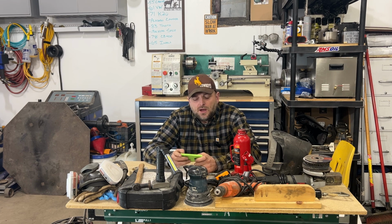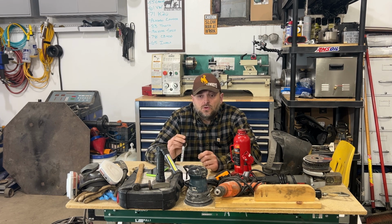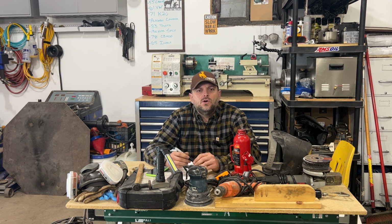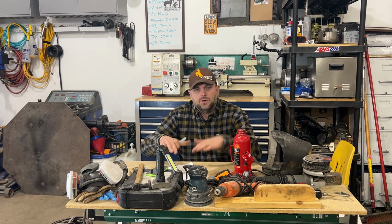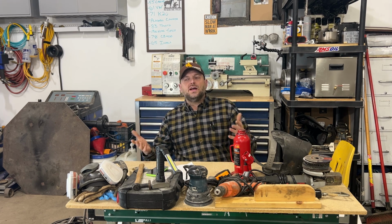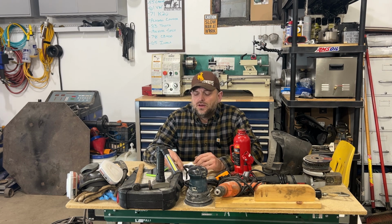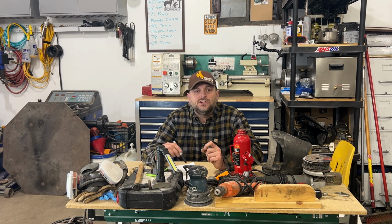And then you can just scroll back through, find your pictures, zoom in, everything you need to do. Take pictures. Along with that, keep a notepad and something to write with handy while you're working, and take lots of measurements, make yourself notes. A good example, like a lot of times on old cars, the front fenders are shimmed because the bodies weren't as precise as they are now. And so you may need to make yourself a note that, driver's side front fender had an 1/8 inch shim at the back and a 1/16 inch up front.